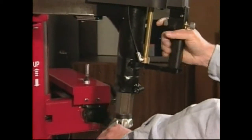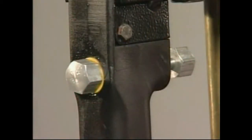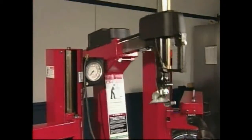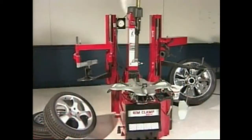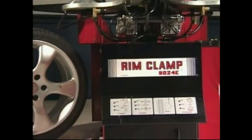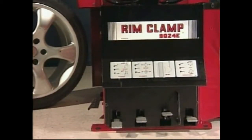In addition, the slide adjustment handle, vertical slide assembly, slide locking valve and tilt tower stop have all been redesigned and reinforced to provide the added strength and stability necessary to service today's larger, heavier tire and wheel designs. And for easier and faster service, the Coates 9024E features a slide-out service module that puts all the critical valves and components at the service technician's fingertips.